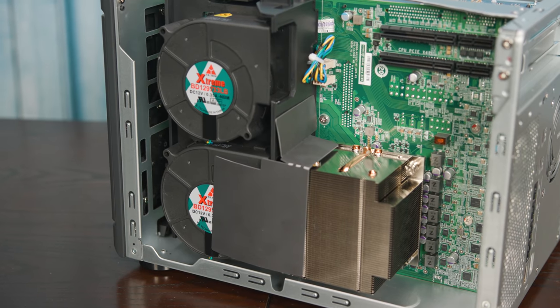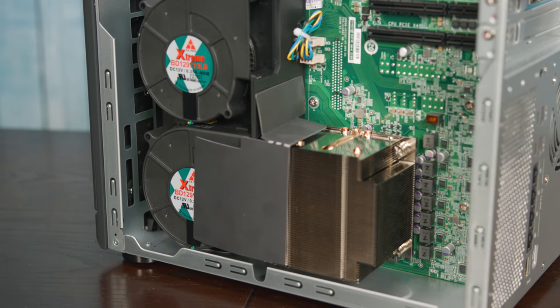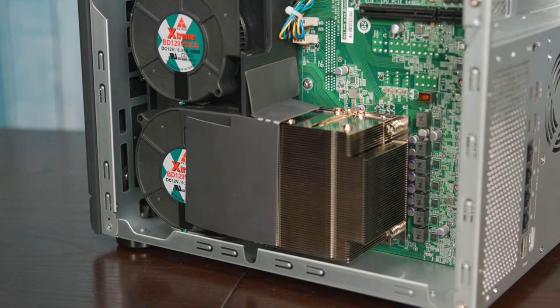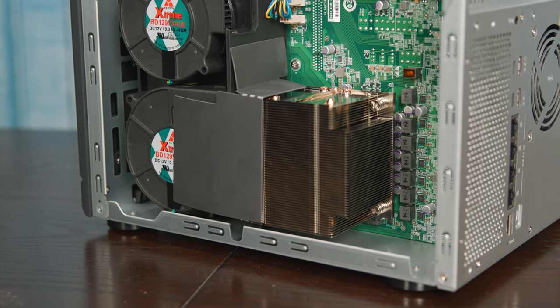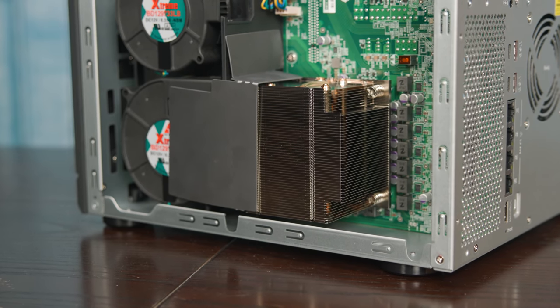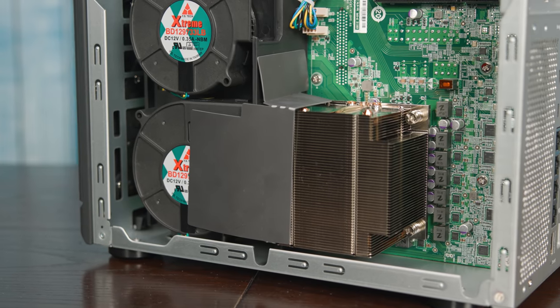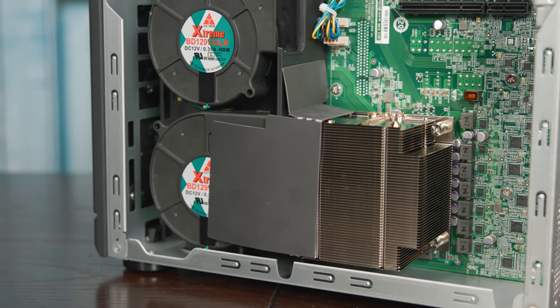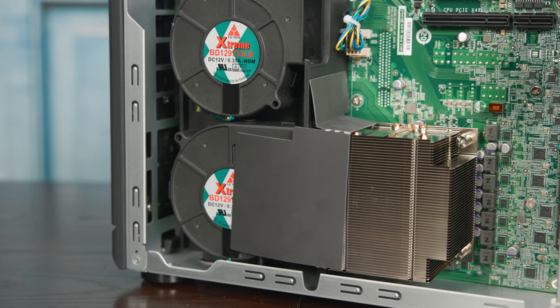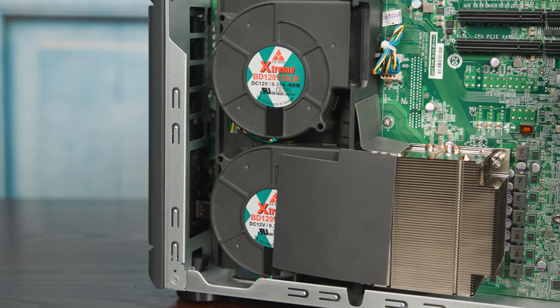The cool hardware doesn't stop there — we actually have an Intel Xeon W-1250 processor. The Xeon W-1250 is a six-core, 12-thread processor with a 3.3 GHz base and I think 4.7 GHz turbo clock. The clock speeds are definitely well above what you'd see in an Atom-range part, and you also get bigger cores that you don't get in the Atom C3000 series that a lot of NAS units use. The flip side is that this is not a 25-watt TDP processor, so you have to cool it in a system that's expected to be quiet.